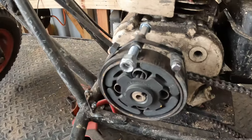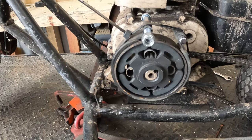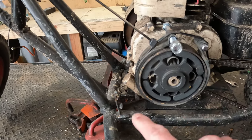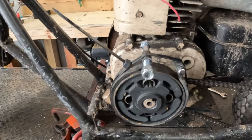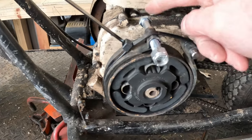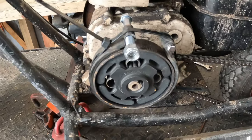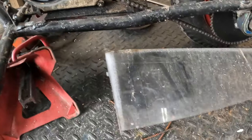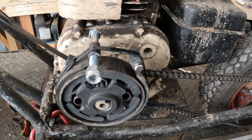I've always liked putting them there — just a more positive brake because you gain the leverage of the sprocket. It turns the brake drum into the diameter of that sprocket when you're braking, so it puts a lot more leverage on the tire and stops you much better. Another pro is your brake cable is much shorter, less cable stretching, and it cleans everything up. We mount the band here, it gets covered up by the chain cover, and we can eliminate a bunch of noise. So that's what we're gonna do — I'm going to start by building a bracket that'll attach our band, bolted right here. Put the band on there, put the cable on, and it's done.